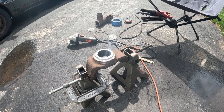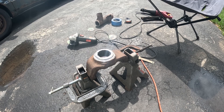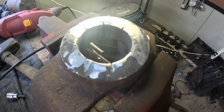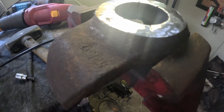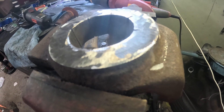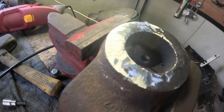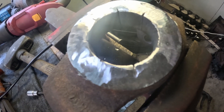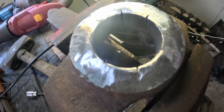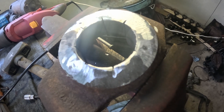Most of that weld is gone as far as I can tell, and the tube is cut nice and short. I'm going to grab the sawzall and cut that into segments, then try to pound it out. After a significant amount of grinding we're now ready to notch this knuckle and start trying to pound it out. There's a very faint line right around the midpoint of the knuckle — that means we are finally through the weld. I tried to notch it with the sawzall and pound it out a little early before actually getting to this point, but now that we're there we can flip it over and give her the beans.